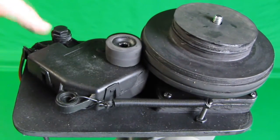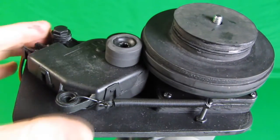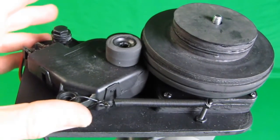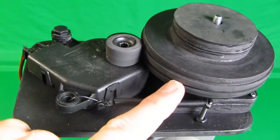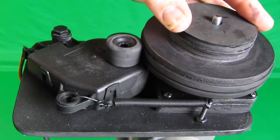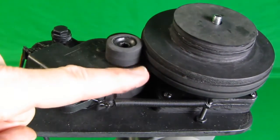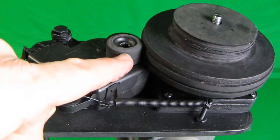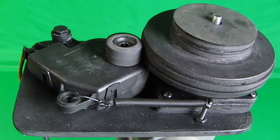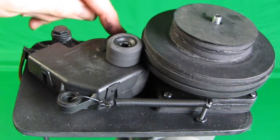This part rotates on one of the plastic sleeves on the motor and has a little nylon bushing. This provides just a slight amount of tension on the rubber wheel, which provides the proper amount of tension for the weight of the camera to rotate, so that it won't have any slippage at the junction of the two rubber pieces.